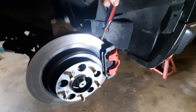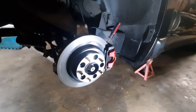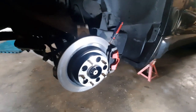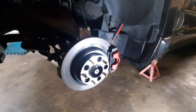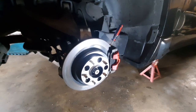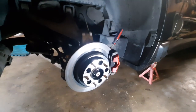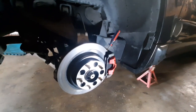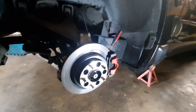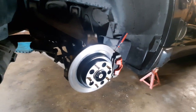I'm going to put a screwdriver in there to lock this side. If you've got it in gear with one side locked, you're basically trying to turn the engine over — because the rotation has got to go somewhere. If it can't go to this side, it's got to go through the driveshaft, and that's hooked to the engine. So lock one side down, transmission in neutral, then go to the other side and put a torque wrench on it.